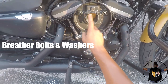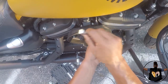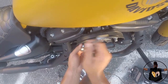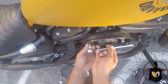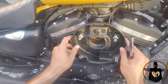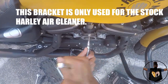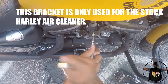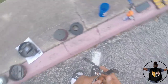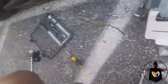Now I gotta take these off here — nine-sixteenths. So now we're taking off the backing plate. I am by no means a mechanic — there are people who need kind of a step-by-step, and this is my attempt at giving you what you need. Alright, so you got both these bad boys, and that should be it for that. Got that plate off. This little T30 torx to get this bad boy off, and that takes off this little bracket. Hex are supposed to be used to take these off but I do not have a hex bit that fits these, so torx it is.